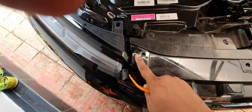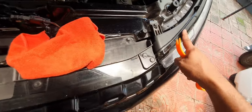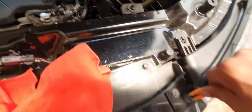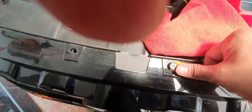There are these types of tap screws which I have taken out from these two ends and this first one, so that I can move the grill. If I want to take out the side I will have to take out these two and this one and this one. For that I would use these kind of panel removers so that you don't damage the paint — insert it and just pry it open. So that's out.